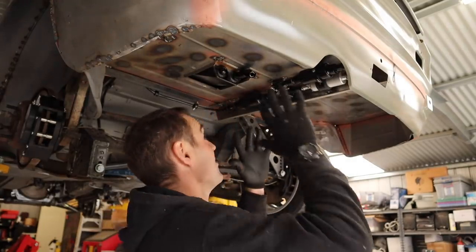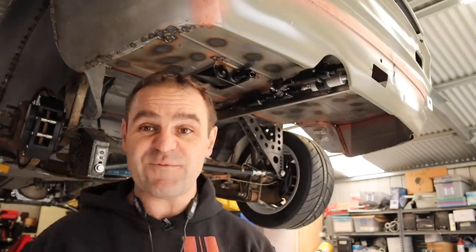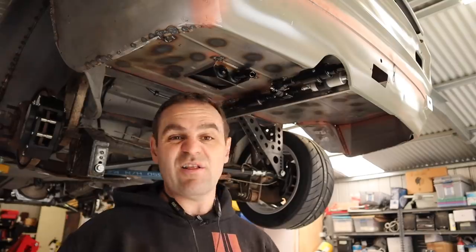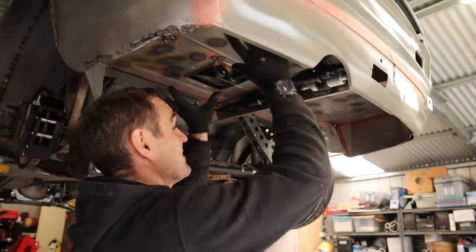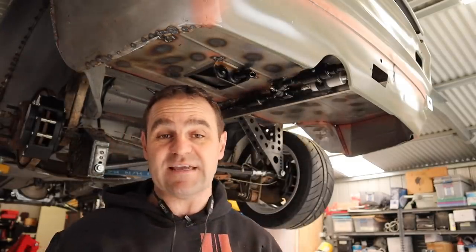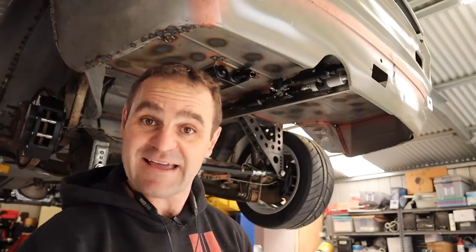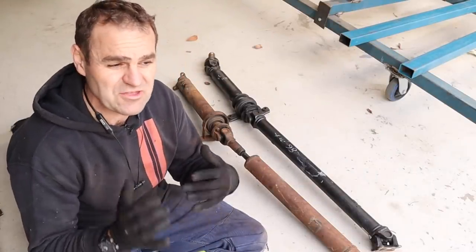The other question was concern that the fuel system is right at the back of the car near the hot exhaust, and yes, if there was a rear collision that could become an issue — but not really any more than what the car had from factory. The factory fuel tank was under the car right next to the exhaust pipe, so it's not that much different from standard. Just got to plan on not getting hit in the back.